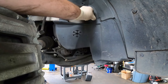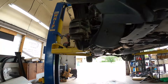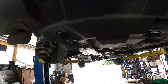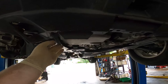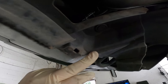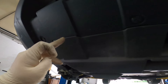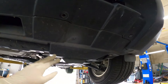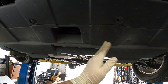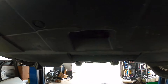I'm just going to go ahead and break this one and I'll have to replace that later. Looking at the vehicle all the way up, I can see this is actually one big piece going all the way around the front. We're going to need to remove the front portion anyway. There's one pop tab, a push tab, and then several along the front. I just want to remove enough — at least over halfway — and then twist it and get it out of the way to make this job a little bit easier.